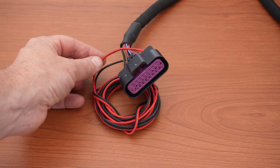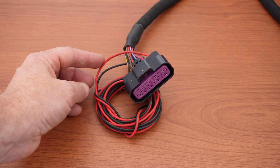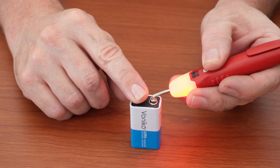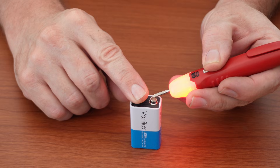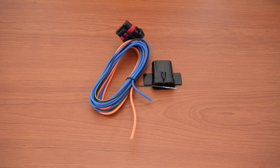This brings us to the ignition wire — there's only one on this box, which is nice. The MSD is entirely digital, and car guys have been spoiled by old-school analog ignition boxes that will run on kind-of-sort-of 12 volts. Digital boxes don't work that way — they're on or they're off. You need a healthy battery and actual 12 volts. Do not use a test light for this connection; a test light will light at a voltage that won't run the box and you'll never know it until it doesn't start. Get the voltmeter. The preferred way to wire this is using a relay, activated by the ignition switch in the car.